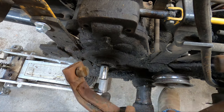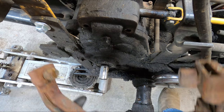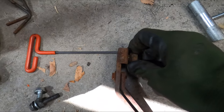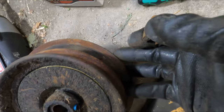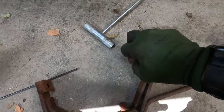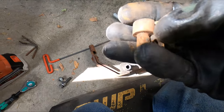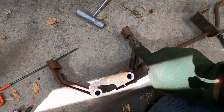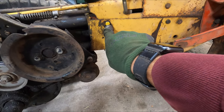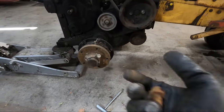Here is your cradle — it's a bit ugly and rusty. Before we stick this on, let me show you where to lubricate so it will operate properly, and this should also be done as preventative maintenance. These pins are held in by the high-low itself via that groove right there — they just nest right in. You want to pile grease into those; there are two, one on either side. Also grease the shafts. Use white lithium grease. You also want to oil your two pivots. That bracket goes right where the shift quadrant bolts on, so you'll need a slightly longer bolt to mount it.